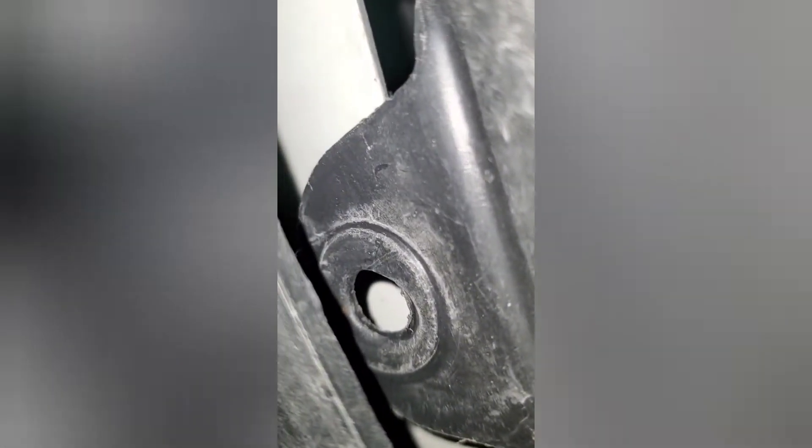This is what it's supposed to look like on the other side — we've got one clip there, one clip there, and one clip here for the wheel well liner. On the other side it's actually cut back here, so I'm gonna get this clip off and pull this out of the way.